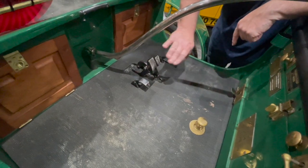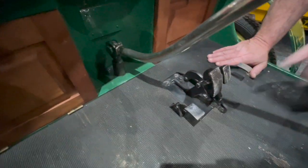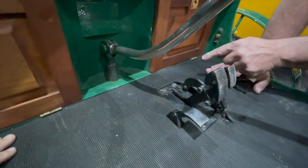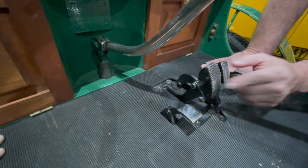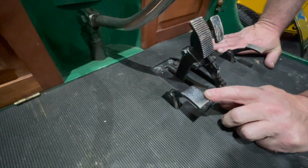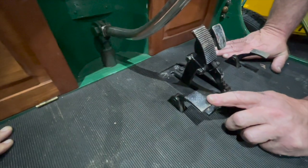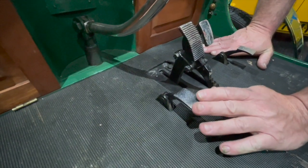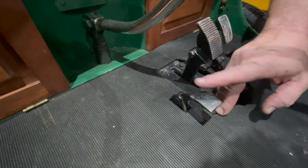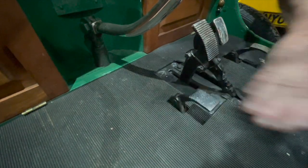Brakes — like I said before, you've only got one brake, and this is your foot brake and hand brake all in one. It works on a ratchet system — so your brakes are on, and they're off. They're either on or off. The pedal next to it is an exhaust pedal — basically it opens a flap on the exhaust and lets all the gases out, so the engine runs quicker and the car goes faster. Useful for going up a hill. They had to put that on as an extra because back in the day the cars were so noisy they were frightening animals, so once you got on an open country road, you open that up and your car takes off.